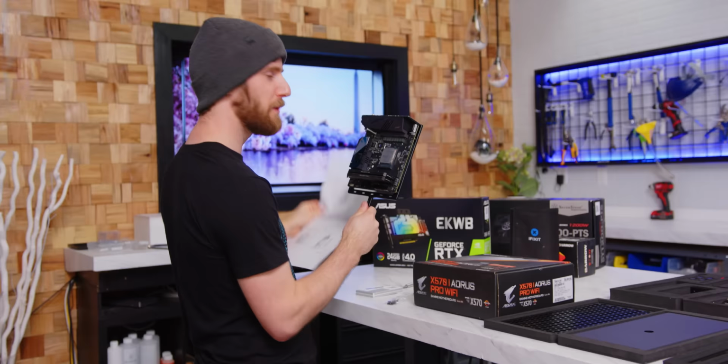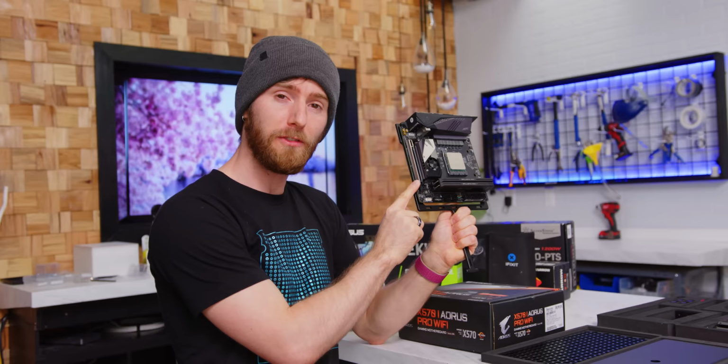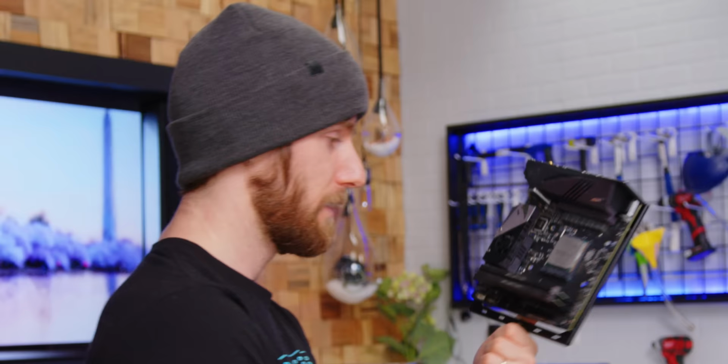Now for the warning, do not skip. They want you to boot up the machine at this stage for two reasons. Number one, because extracting a defective part at the end of the build is gonna be extremely time consuming and difficult. And number two, you need to reconfigure this PCI Express slot to run at Gen 3 speeds because the riser that they've got is not a Gen 4 capable riser. So we've already done that.